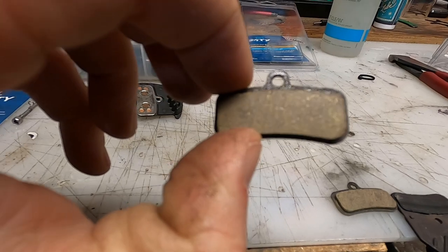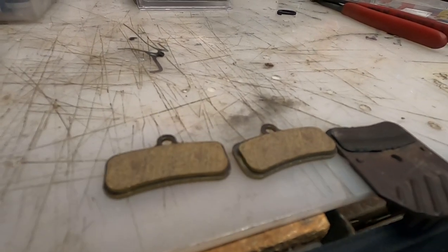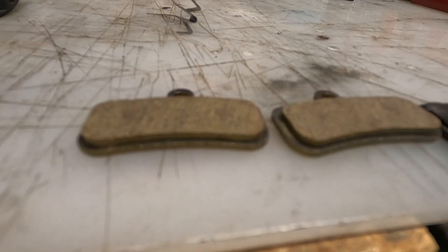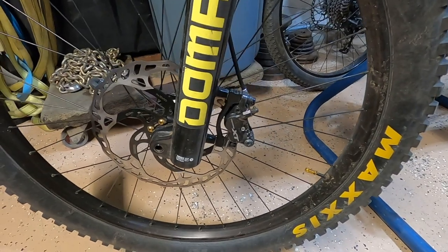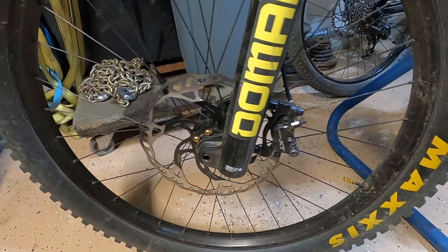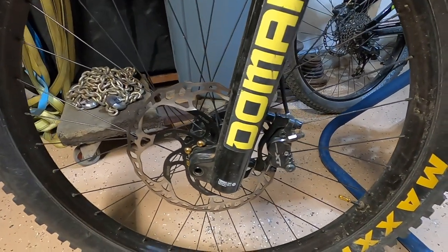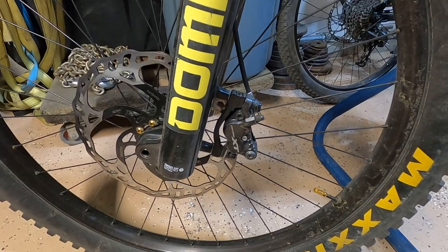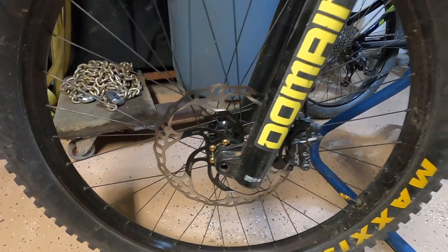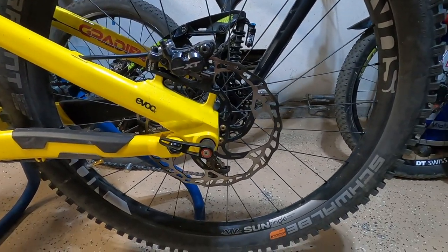I can tell on my last ride I was just not having a good time. If you watch my videos, you can see that one video where it's pretty damn frustrating — I could not control my bike. When you can't control a bike hauling ass down a mountain, especially on trails I was not familiar with, it gets a little sketchy. I've tried everything I can to slow this thing down. It's an 80-pound bike. I got the four-piston. This thing originally came with a two-piston Tektro — a 203-millimeter rotor up front and a 180 in the back — and those brakes didn't cut it for my riding style. So I did 203 front, 203 rear, got the four-piston brakes, and it improved quite a bit. Then once I upgraded to these 223-millimeter Galfer rotors, that's where I really noticed a huge improvement in braking. From the research I've done, everyone's saying you don't really need to go that big with the rotors — it's all about the pads.